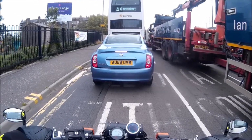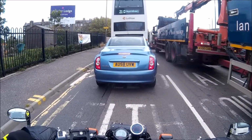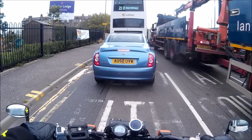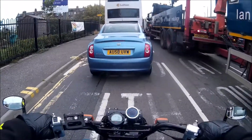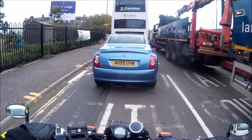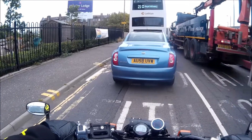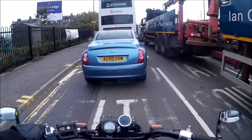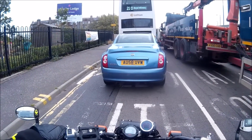What you can actually see on the dial here is I turn the throttle. Now normally the bike heads pretty quickly into lean, but it's actually reaching a point where it's heading back into rich again, which I think must mean the iMap is putting the extra fuel in. But I think we can probably go maybe a bit higher than 20%, and I think we can maybe go a bit sooner than 20%. Anyway, I should be consulting with the expert first.